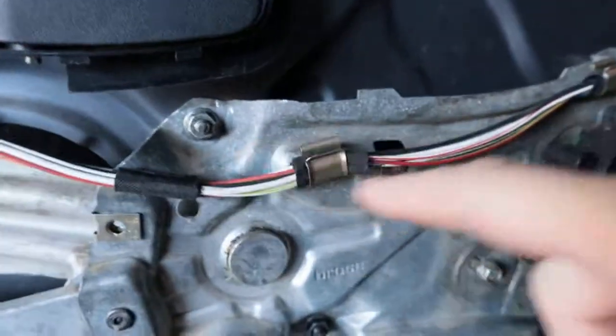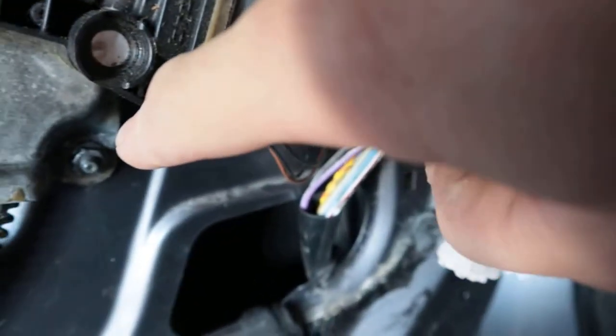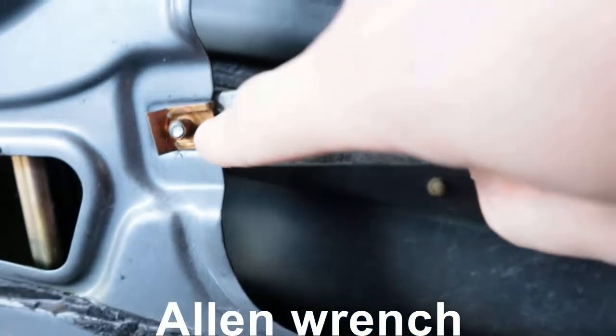If you've never done a window on your car, here's the thing — you have to take out this entire window regulator. There are four bolts: one right here, one right there, right here, and right here, plus a bracket-type thing. When you take the door panel off, look at your door — you might have rivets. If you have rivets, that means you still have the original motor or regulator on it, or whoever worked on it put rivets on. I have bolts with nuts on it, so I'm going to take this out.